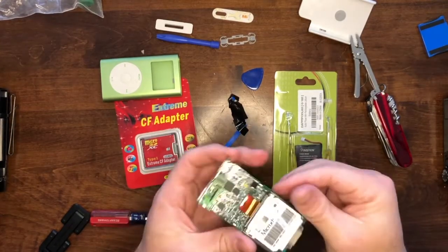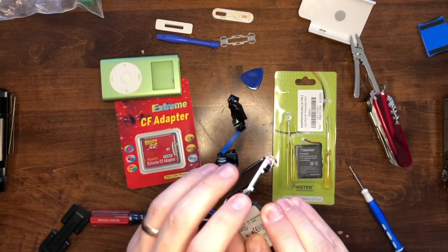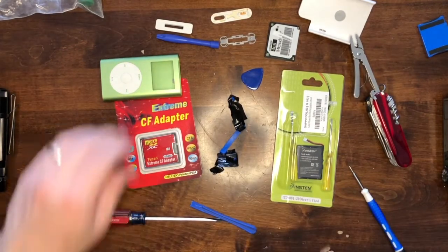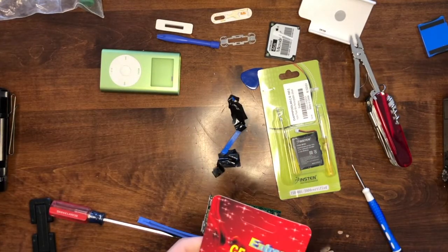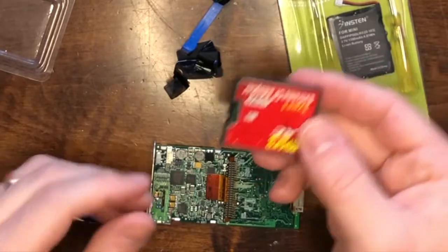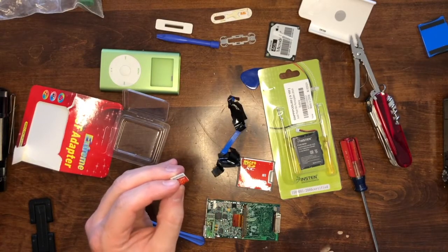Let's put those corners back up. Now the pins — gentle. Started to come out. Perfect. Let's get into our bits and pieces. I'll start with the CF card adapter. Should work fine. And we're going to be putting in a Samsung 128 EVO. I just formatted it for Mac OS Journaled — let's see if it takes it. If not, we'll be reformatting and starting again.